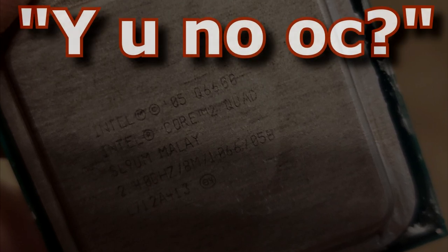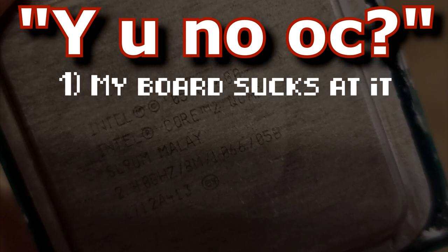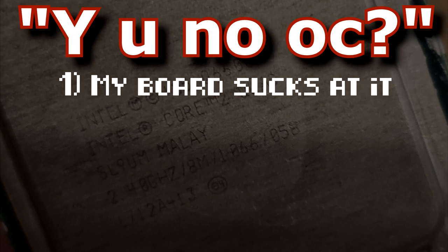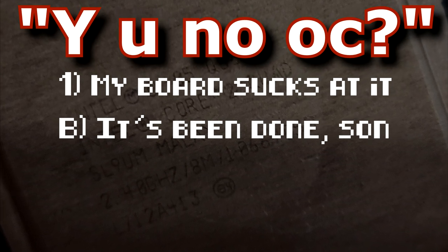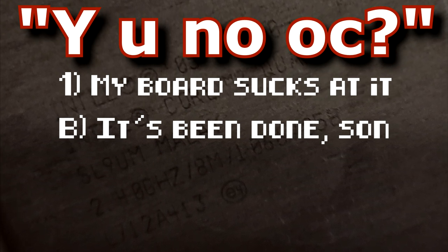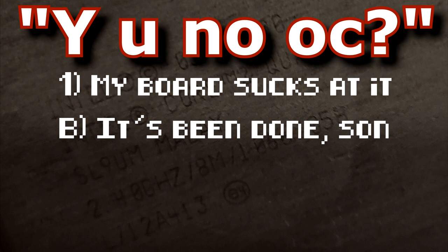Let's start with some benchmarks. I will not be getting bogged down with overclocking, and that's for two reasons. First, this board isn't a great overclocker, and I wasn't able to get much stability past the 2.4GHz base clock. Once I tried to get much past 2.6GHz, no amount of voltage, frontside bus, or other settings could keep things stable. Secondly, this processor came out in 2007 — there are hundreds if not thousands of videos and forums regarding overclocking this chip. The only unique information I'd have to add is that the G41M-P34 can't push my individual Q6600 silicon much past a 200MHz overclock. So all benchmarks moving forward are at stock settings. Suffice to say, 200MHz of an overclock wouldn't be a jaw-dropping difference anyways.